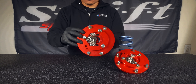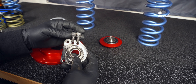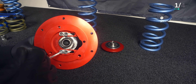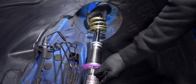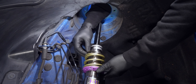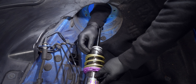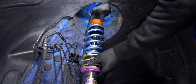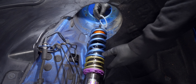There are two positions for the set screws. The outer settings on the flat side will allow you to get all the way sideways, while the inner setting towards the curved end will allow you to slide it back to the stock setting — this is where I'm going to start until I can get an alignment. The set screws are a quarter inch hex, and hand tight is fine for now. When you drop in the helper spring, you'll have to press it into place as the inner diameter is a little smaller than the spring perch. We want the helper spring on the bottom versus the top, so these components don't get misaligned as the assembly goes up and down. As long as we have some preload at full droop, we should be fine — but better safe than sorry.